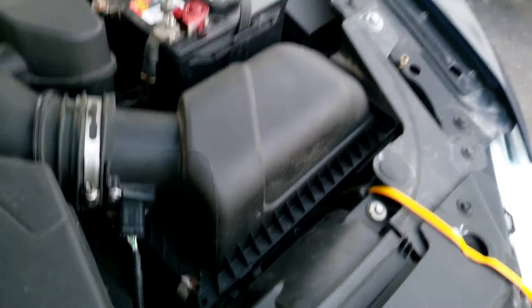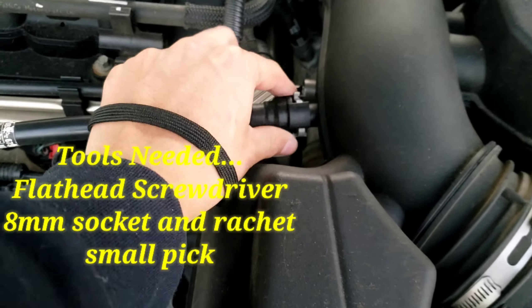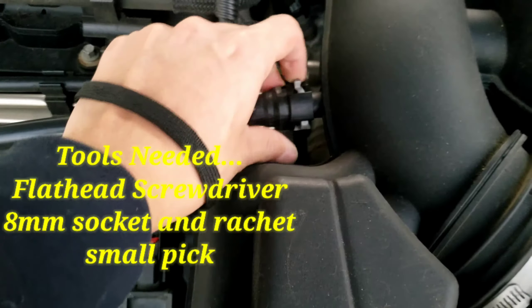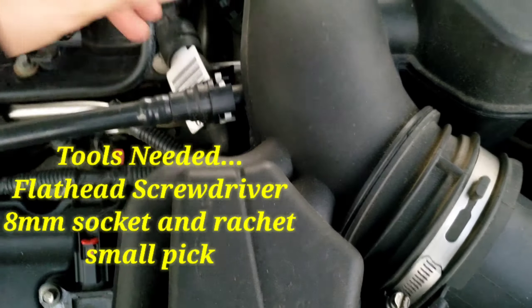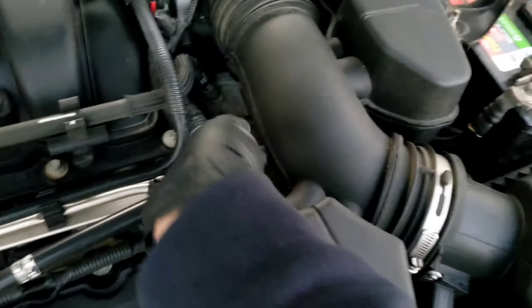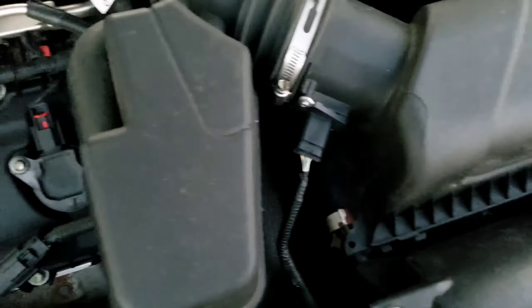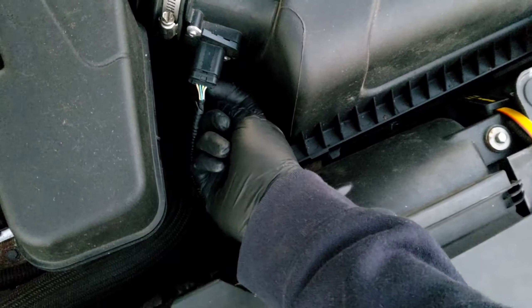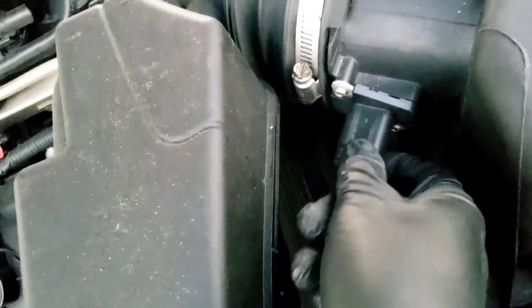The hard side is the driver's side because you've got the air filter box in your way. So I'm going to show you how I remove the air filter box. First, you just disconnect this hose — you push both of these sides in and it snaps off. Then get a little pick because there's a little red tab under here; pull it forward and disconnect it.